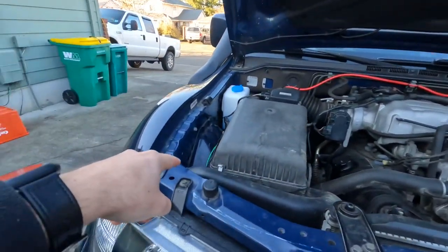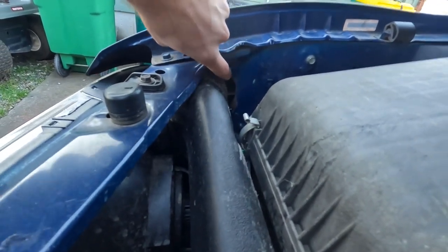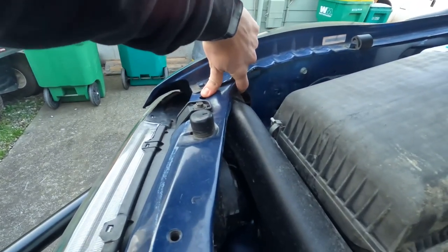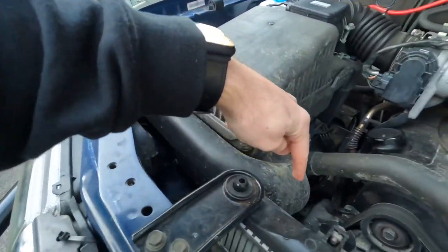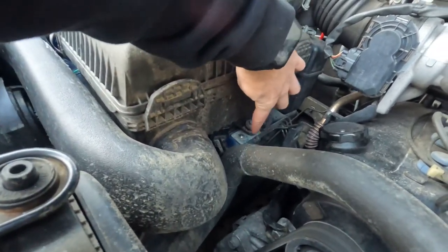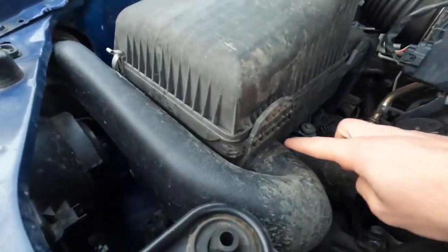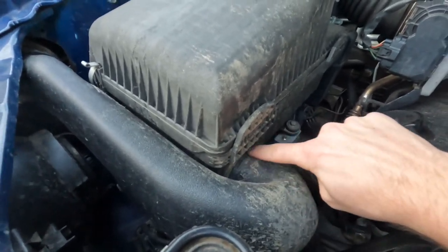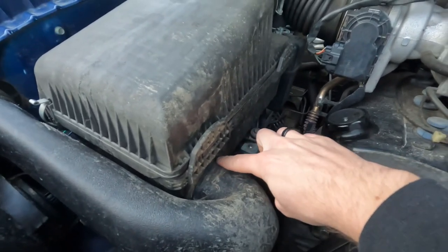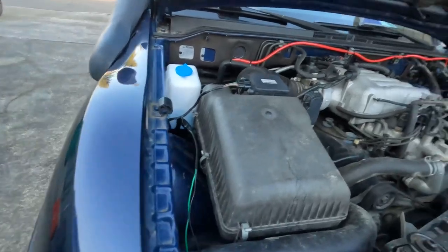It comes through here and you're going to have to cut a hole right here into the side of this fender. This hole right here I actually just used an angle grinder to do that. And then it comes around — you have to move the airbox about an inch back, and it comes with plates for that so you can just kind of shift the whole thing back. And then I just used this gasket sealer and poured a bunch of that right there. As you can see, I already took it a little bit of mudding and I put it on there and we are all sealed up inside of here.